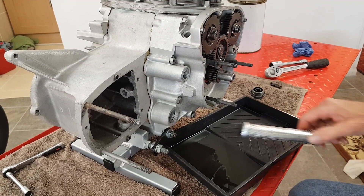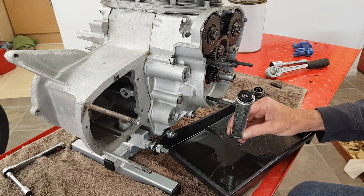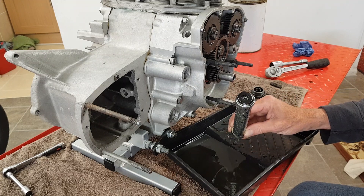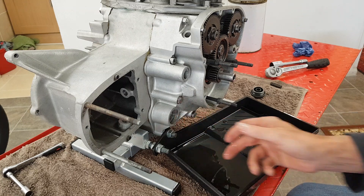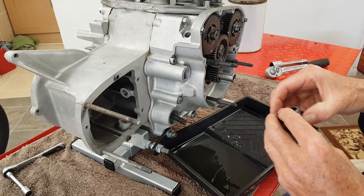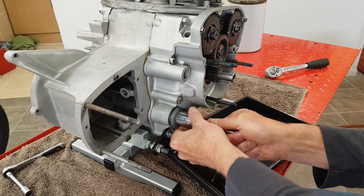So we're going to fit the oil filter. I'm going to slap a bit of oil inside the filter — just pour some down inside. And then it simply slides in. Spring over the tang, and then the cap over the spring. And on it goes.